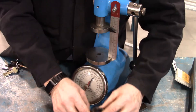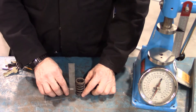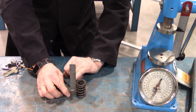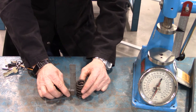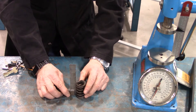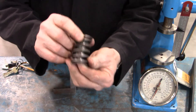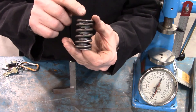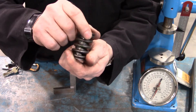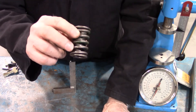When we're looking at these springs, the first thing is simply to make sure it is square. You can see that this spring is almost touching on this side in this location, and as I turn it around it's starting to move away from the bottom — now it's touching at the bottom and moving away from the top. That tells me this spring has a little bit of distortion. The problem is that when the valve is being pushed off its seat and opening, the spring is going to be kicking it a little bit to the side, creating more wear between the valve stem and the valve guide. So that would be one thing that would fail this spring right away.